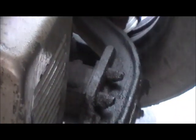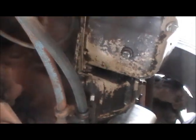That's the emergency brake right there. It's like a brake drum right there, and it's on the drive shaft, and that's what they use for emergency brake. It just latches around the drive shaft, and that's what stops it. And that was non-existent. I mean, it was completely worn out when I got it, so that had to be redone. And as you can see, I got some, now this is all old leakage right here, all oil leakage along the bottom here, and it's all coming from right up in here, right up in there somewhere is where it's coming.